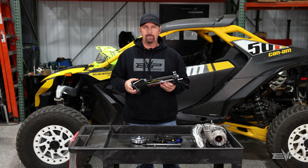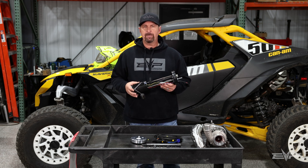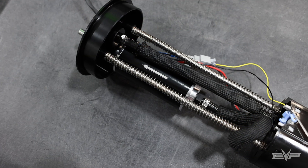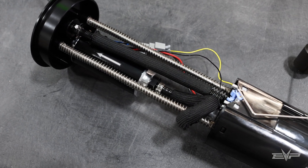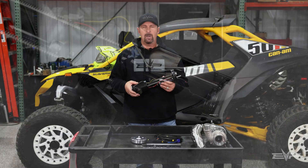It has a built-in surge tank, very, very good. The problem with it is the pump itself is very small, which is a problem when we're trying to run E85. Even on the X3s, we had to replace the pump itself on E85.